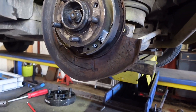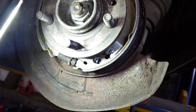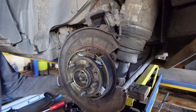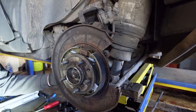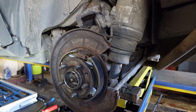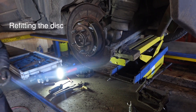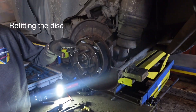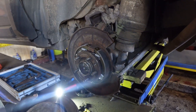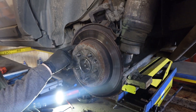So I just fit them on every single one whether they need them or not. Now with that fitted, we've virtually taken all the slack away — there's about a couple of mil if you're lucky. I could take that back off. Even though Land Rover will tell you to undo that, tap it with a hammer, and then tighten it back up again — which just never has worked. You can't get this on, then you'd have to go back and move that back up. It all depends — sometimes it'll just go on easy, which I'm hoping now. Just like that. But if you've overdone it on that, you might not get that on.